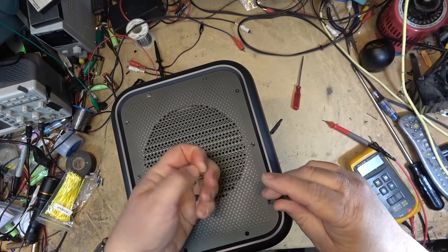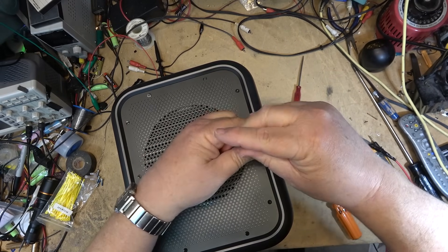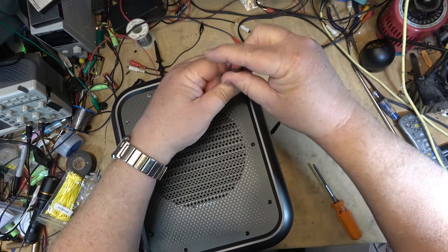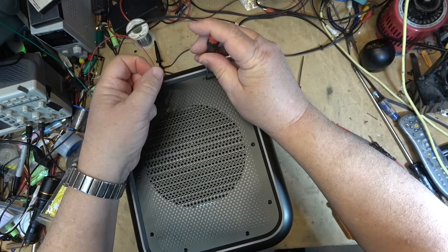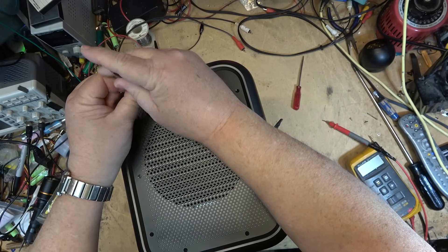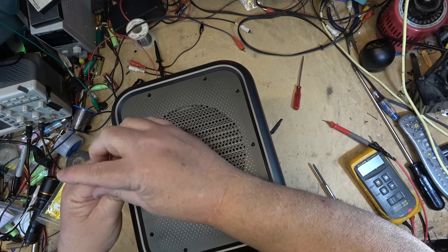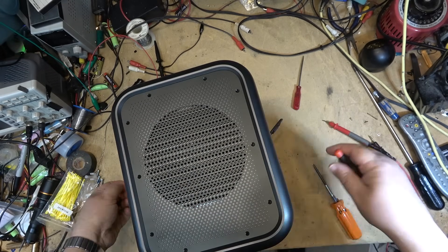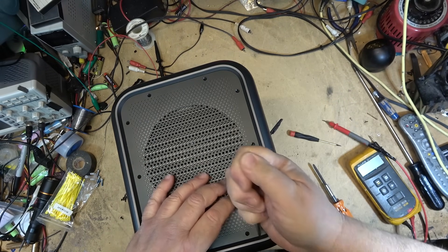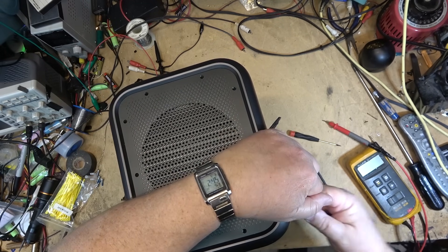Let's tear into this one and see what went wrong. I've got to remove all these little Torx screws. I want to take a look at the battery pack and see what voltage it's at. Maybe I can hook up my power supply to it and bring it up a bit to get it out of its locked-up state, or even maybe disconnecting and reconnecting it will allow the CPU to reset so I can at least charge the unit up. This one is a lithium-ion pack - not one of the newer lithium iron phosphate units.